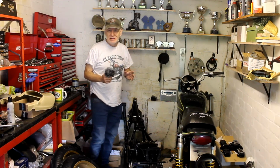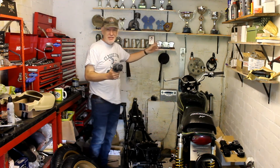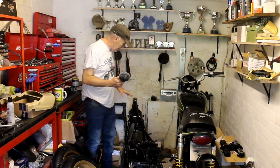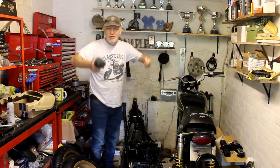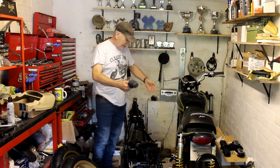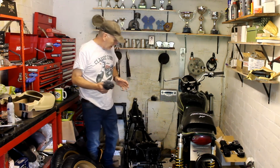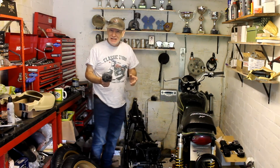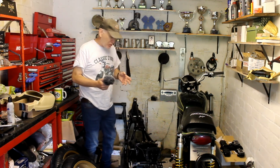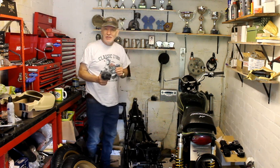because I was hoping to wait until the engine was complete, then we could take the frame over to Liz's garage, lay the engine on its side, and then put this frame over the engine, get the engine bolts in, lift it up, and we're all good. That's a great way of fitting the engine. It saves a bad back, it saves a lot of stress, because you're worried about scratching the frame when you're trying to manhandle a heavy engine into the side of the frame.